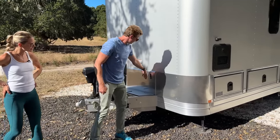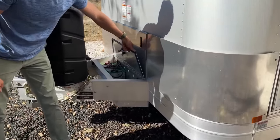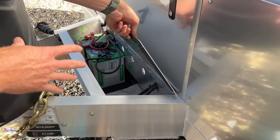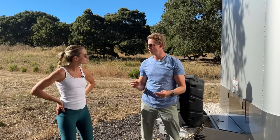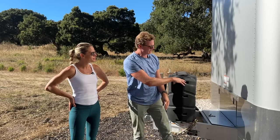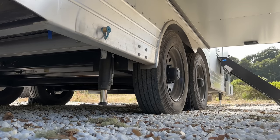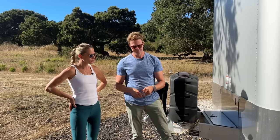Generator compartment right up here. We also have dedicated batteries. This is a hatch — and this is a dedicated AGM battery. The reason we do that is because it's located on the exterior; AGM batteries tend to be more robust so they can freeze more and are not as sensitive as lithium. All the lithium batteries are inside. This battery powers critical systems like solar awning, leveling jacks, and hitch jacks. So if you need to get up and go and your energy system has a problem, you're going to have that one critical system always running.